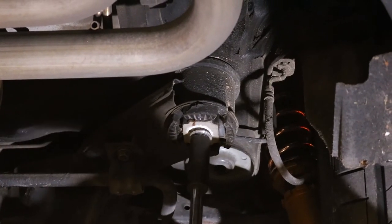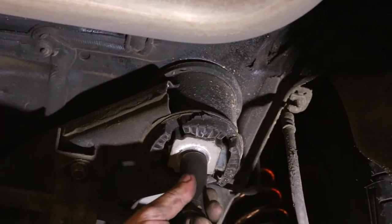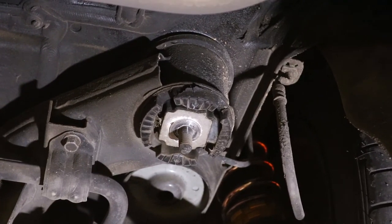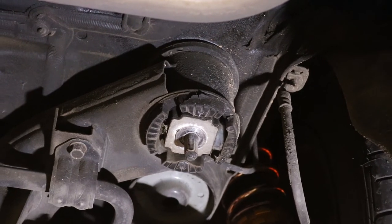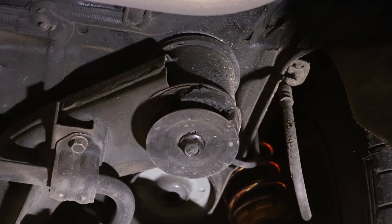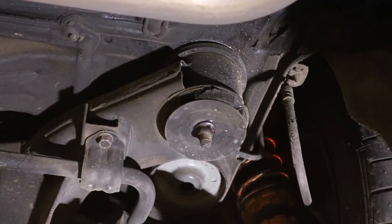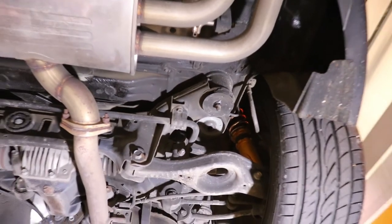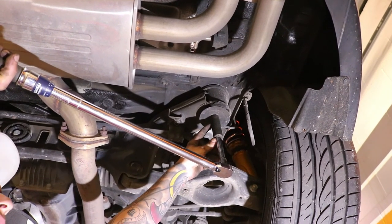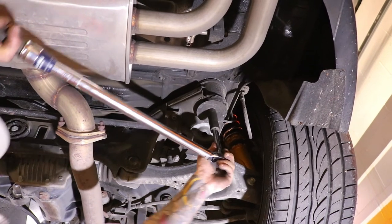Once I've got this in with the impact gun, I'm going to put it in reverse and take the nut off. As you can see, the stud is now completely centered with the bushing, which is exactly where it should be. Now I take the plate and put it back on — the indent sits at the bottom — put the nut back on and use the impact gun to tighten it up. Then I'm going to torque everything to spec with the torque wrench. You can actually use a deep socket 19mm instead of the shallow one to make it easier on all models.